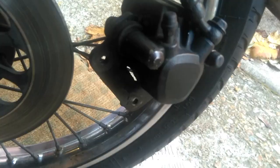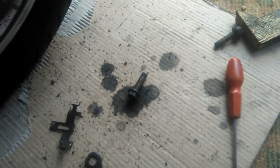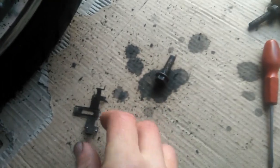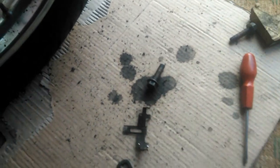It's not playing ball. So what we have here is the caliper mounting bracket, and we push this towards the main caliper body. Once that has happened, the pads and the spring clip should all be easy to remove. The pads aren't size specific. These have absolutely had it - I didn't expect them to be quite this bad, actually. This spring clip is a bit of a devil to remove - it hooks that way up.